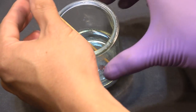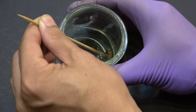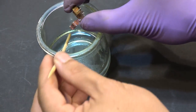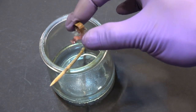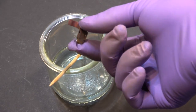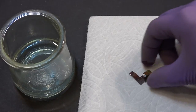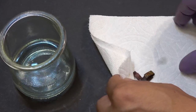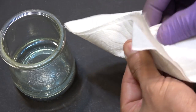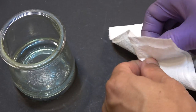It's been only about five minutes and it didn't take long at all. The bubbling has stopped and the blue stuff is absolutely gone. This looks more like copper now — no more blue stuff sticking on the metal. What I need to do now is clean this up and neutralize the acid on this piece of metal, because if you just leave it like this it will continue to corrode the metal and turn blue again.